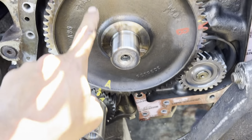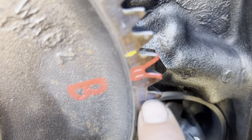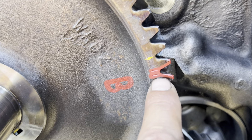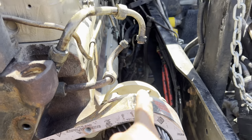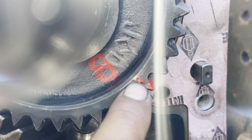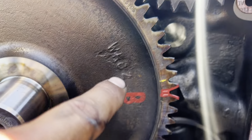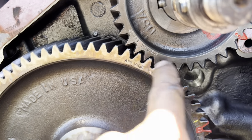This is the camshaft gear, and the camshaft gear has two little lines — slashes or lines. Then for the air compressor gear, or accessory drive, it has two little zeros or two little dent holes, and I put B.